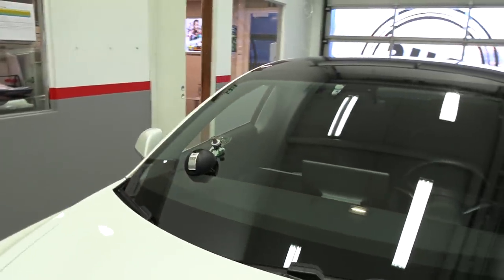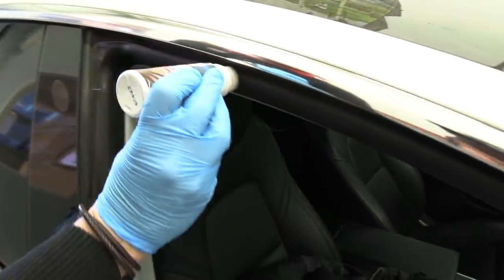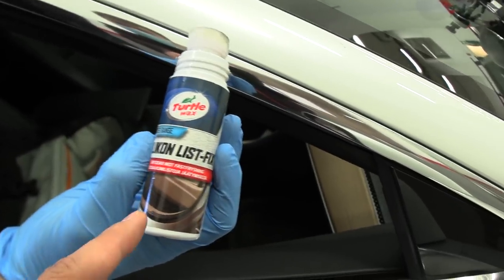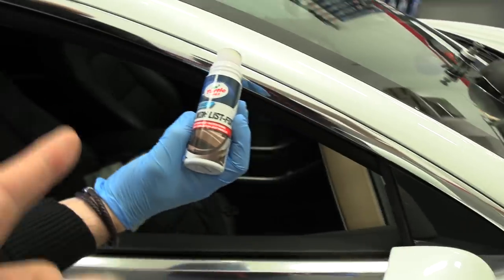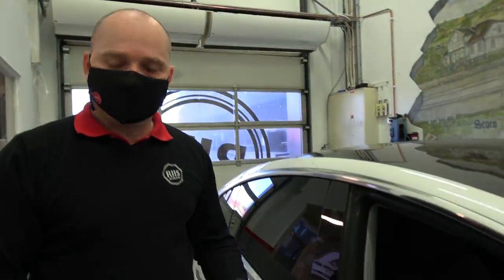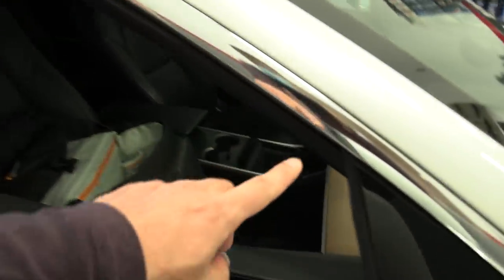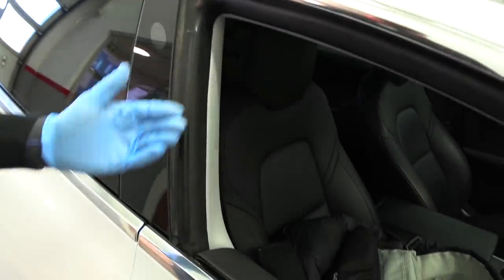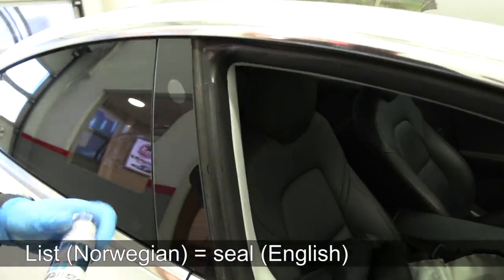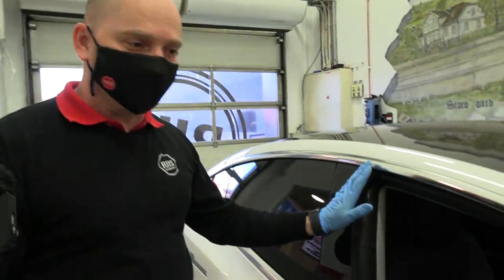Let's wait for this one to dry. Another tip Roge told me is that you should put some silicone — Turtle Wax silicone fix. How often should you apply this? He uses it every time he washes the car — weekly, almost. Roge also owns the Model 3. So it will make it not stick, because when you wash the car you dry off the seal with paper or cloth and use silicone stuff after. Then your window will go down when it's cold and it won't freeze to the seal.